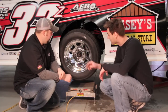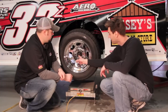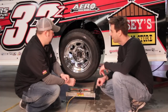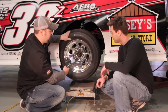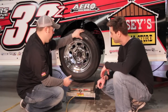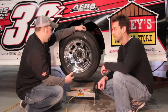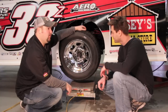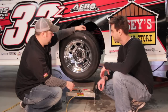You don't actually pull the axle all the way out of the axle tube — you just disengage the gear on the inner part of the axle from the ring and pinion gear. You just want to unlock it from the splines on the outside drive splines, so this wheel will now turn without the right rear turning — they're disconnected essentially. Sometimes this is a part that can fail in a race. Guys have DNS'd because a car is not drivable with just one axle; it can't drive properly with just one tire.